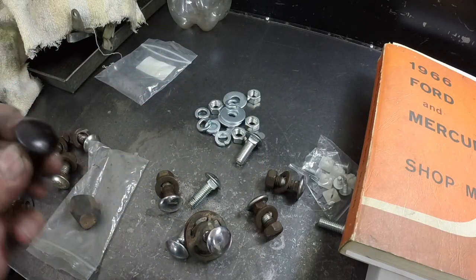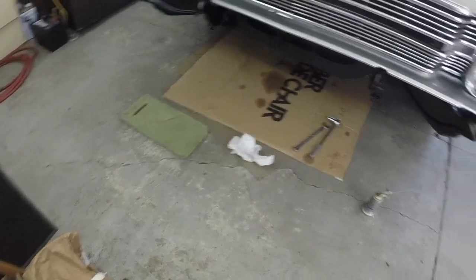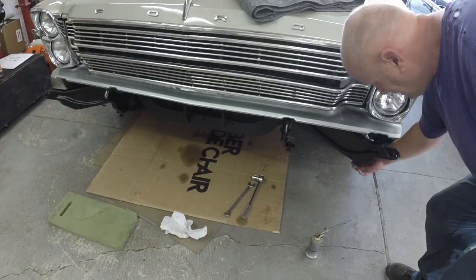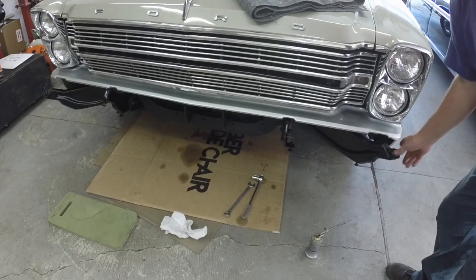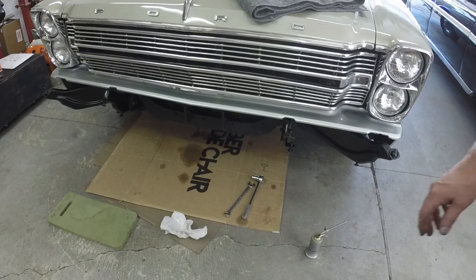But I took one of the bumper bolts out, and I'm going to clean the paint off and buff it, and I'm going to take them all out actually. They're all still in the brackets here, and I did that so I would remember where these were. The rear ones, I think I wrote on them, but I left 2 out because it fit better like that. So I'm going to take those all out. I'll just tape the shims where they are and clean the paint off them with a little bit of paint stripper. We'll have that paint off in a couple seconds.